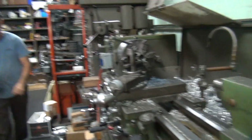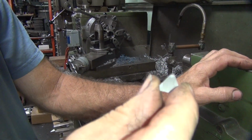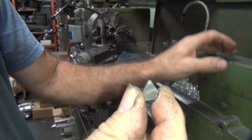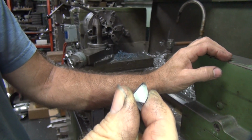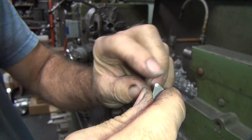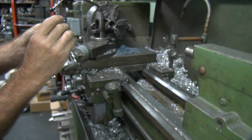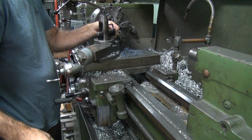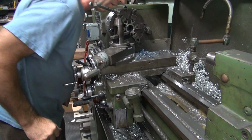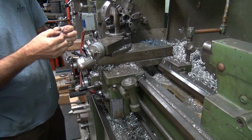See how that works. So what'd I do? Sharpen it on the grinder. How? Well, you hit all the edges, cut the nose down real flat, and I put a negative on the front. Negative for high pressure applications. Yeah, we want a positive. No, you don't. You're always negative. That's right.